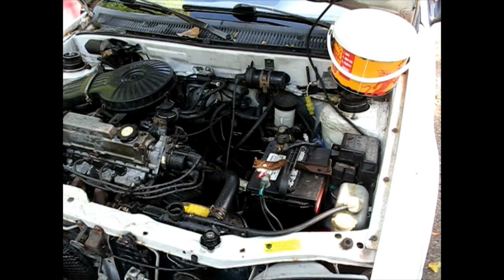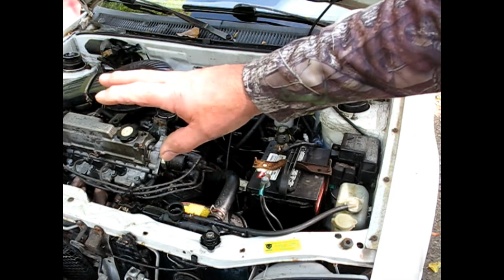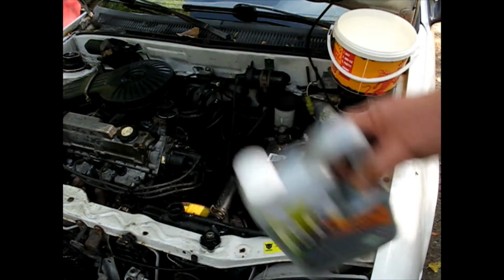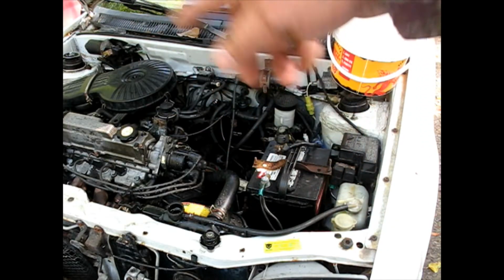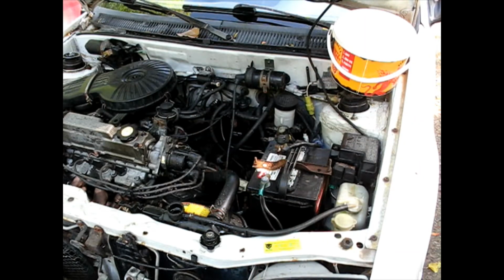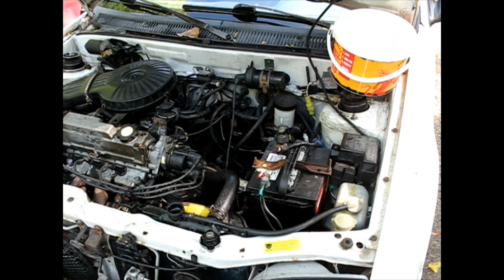Use whatever you dare, but I'm only doing the heater core, and not the whole coolant system in the car, because then you're potentially going to eat up your head gasket and hoses. I'm going to try the old-fashioned CLR. Maybe vinegar would work, maybe anything you've got would work, as long as it's not going to eat the aluminum. If it does, I've already got another one. In your case, you don't just put it in the radiator, which would do the same job and clean everything, because then you're potentially etching out your head gaskets, which have coolant passages in them, just like around the cylinders, and you probably just don't want to mess with all that stuff.